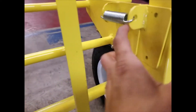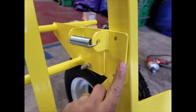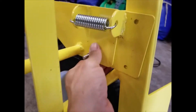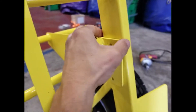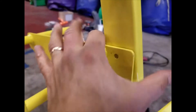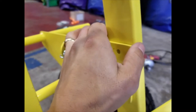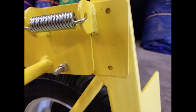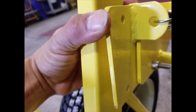The goal is to have this lined up just like this. Note that this edge is not designed to line up with this edge, so don't try to make that happen. You want the front top corner of the mounting bracket to be flush with the frame rail. You don't want it sticking out where it can catch on something, and you don't want it further back. When it's flush with the frame, both holes will be drilled through where they're not too close to the edge of the frame rail. Double check on both sides that you have this alignment right.